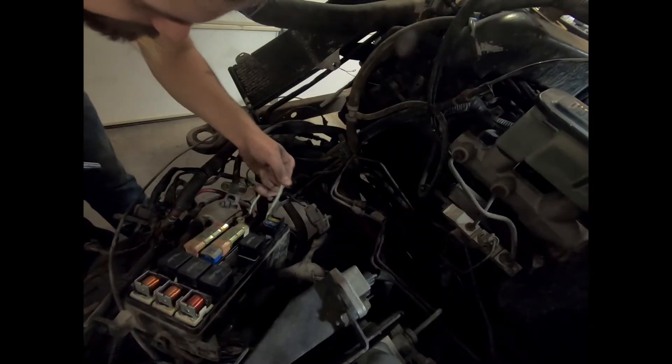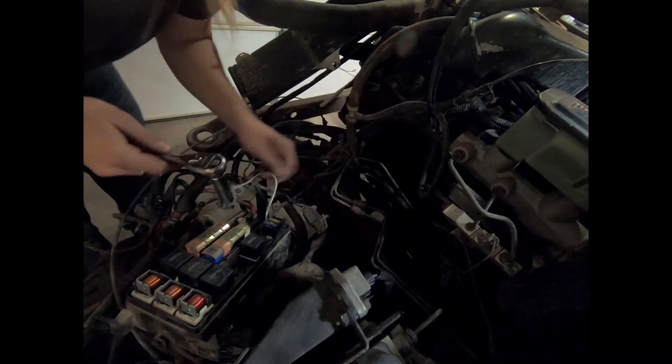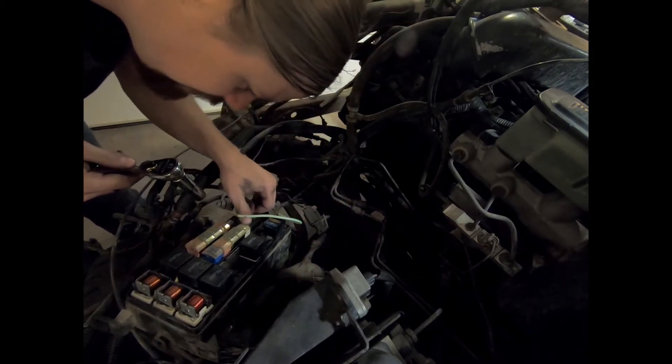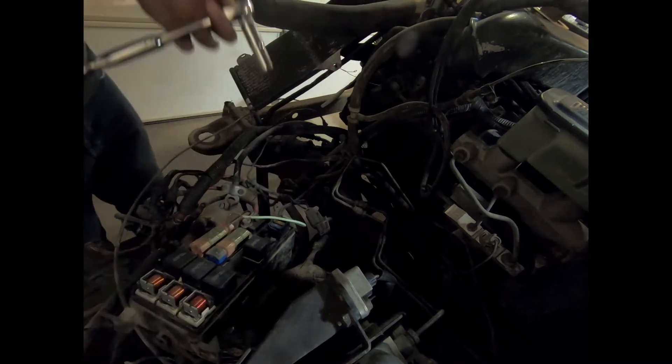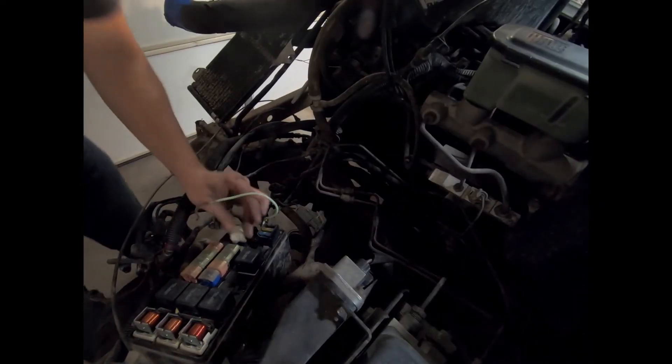What is this wire? It looks like it goes straight from positive to negative, but that can't be negative. I think they were trying to hotwire the alternator - they're bypassing this fuse. Can you tell why they're bypassing that fuse? Because it's real blown. Rather than replace that fuse or fusible link, whatever you want to call it - they risked fire. I'm really glad no one burnt this to the ground before I got it.